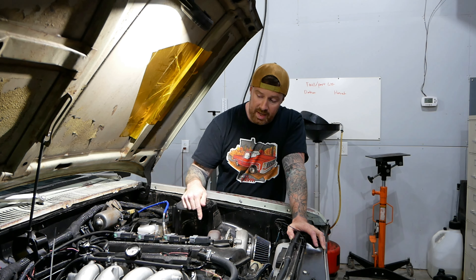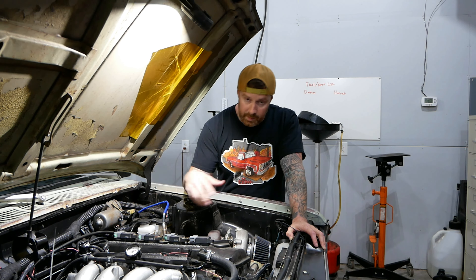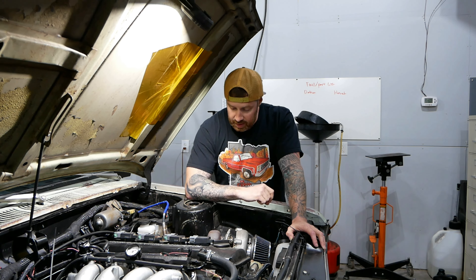When we get this out of here, we've got to go up in the air, disconnect it from the rest of the exhaust, then disconnect it from the turbo and pull it off the top. Then we can actually look at how I'm going to fix this.